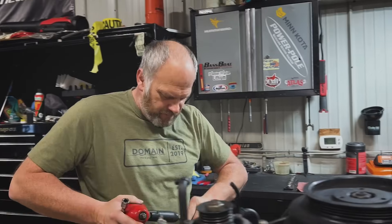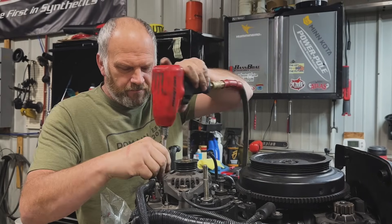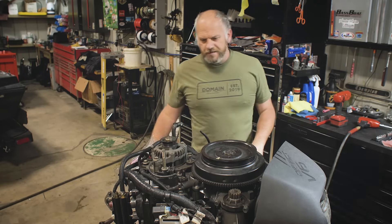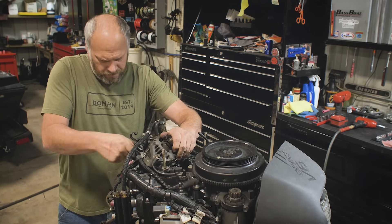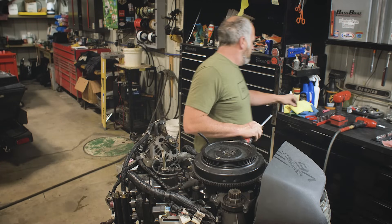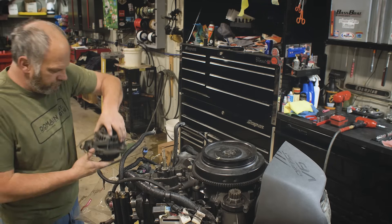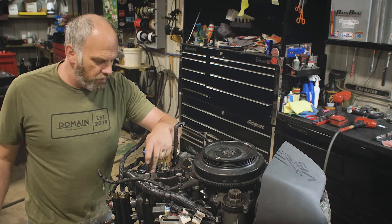Get the big dog off? Just get it over with, get this stuff apart and get to the good stuff. From 8 to 10, from 10 to 8, from 8 to 10 - for the top. There's your alternator. I just like to leave the bolts in here, I can just set it here on my cart - just sits there, no washers underneath. I was taught to undress powerheads in bulk chunks - it saves time, keeps things together, less clips, less things that can go wrong. Take them off in chunks, four at the most, making sure you're bagging everything as you go. That's the way I was taught.